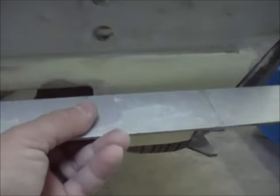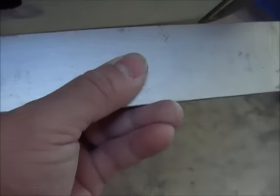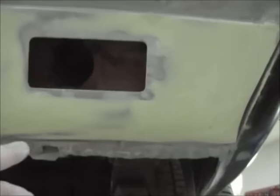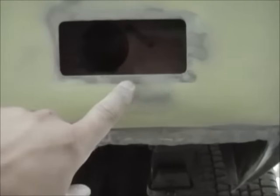So I put this little flat piece up here and you can see now it's flat. I've basically done all the body work here — I put more filler back in it. My dilemma was, if I've learned anything, you don't want Bondo on the edges because it'll chip out. I don't know how far the light will come out over top of this, so I taped off all the edges and skim coated the whole thing again, then pulled the tape off and blocked it back down so the whole thing is perfectly flat.